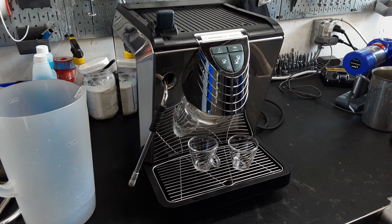And it's a tedious job, kind of expensive job too, and so I would be very cautious. And also, now that we put the new pump in and fixed that issue with the scale on the outside of the machine, your machine works definitely better, but you could tell there's a few clogs here and there. This machine, they did not cheap out on piping. It's a lot of copper pipes, which is really good, what you want in an Italian machine or in any espresso machine. But the issue with that is when you don't descale, like the previous owner have not descaled, you start clogging a lot of places.